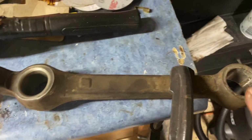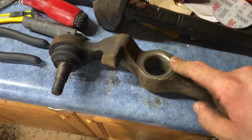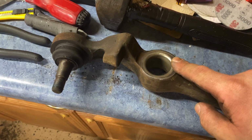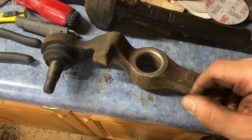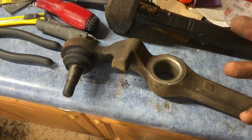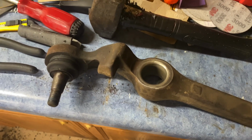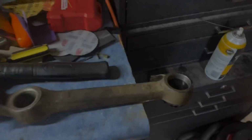We have to just install these bushings, throw the lower control arm back together. We're going to put in the front stabilizer bar or radius rod bushing, and I will show you that paperwork here in a second because it does come with extra washers so you can adjust the caster, but I will show you that as soon as I get these bushings installed.